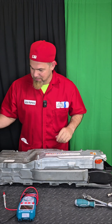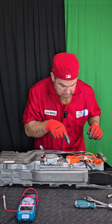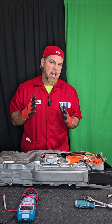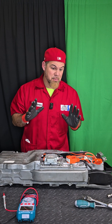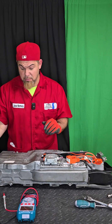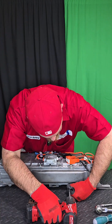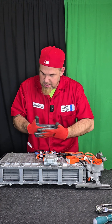This battery is bigger and still nickel metal hydride, so it's ridiculously heavy. Let's open it up and see what's going on. Taking out the covers now — here's the service plug grip connection, the main fuse of the battery on the positive outlet, and the battery voltage sensor. The customer sent a diagnostic report saying the battery is giving a short circuit, apparently in one of the temperature sensors.